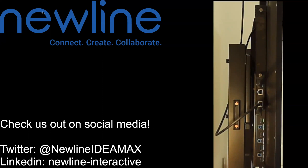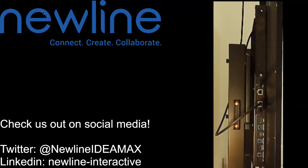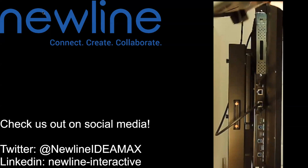In order to install your OPS unit, you'll notice there are a couple of screws covering the OPS port. I'm going to go ahead and remove those. Then this plastic cover — all you have to do is get a hold of it with your hands and just slide it out. That's all it is, just blocking that port. Now you can see the OPS slot has opened up.